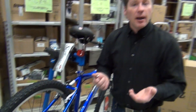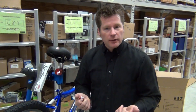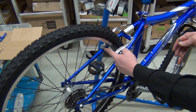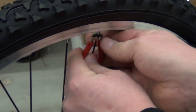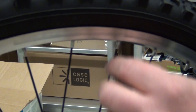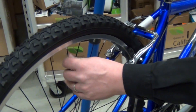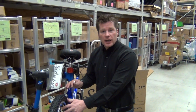If the wheel is really bad, we want to stop and consider replacing the wheel, providing a warranty, replacement, or repair ticket - this is just for fine tune adjustments. To get the rim to move the right way, I'm going to loosen this particular spoke in the center and tighten the other two spokes. The spoke nipple is the threaded end of the spoke head. By loosening one spoke and tightening these two, it allows the wheel to go over to the other side, away from the brake pad. This gives you a great overview on a quick way to make a fast change to get it on the floor.